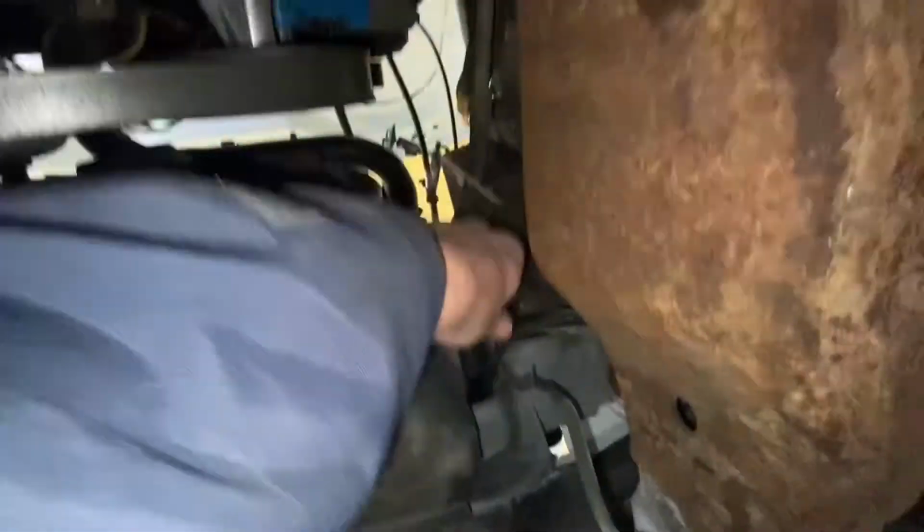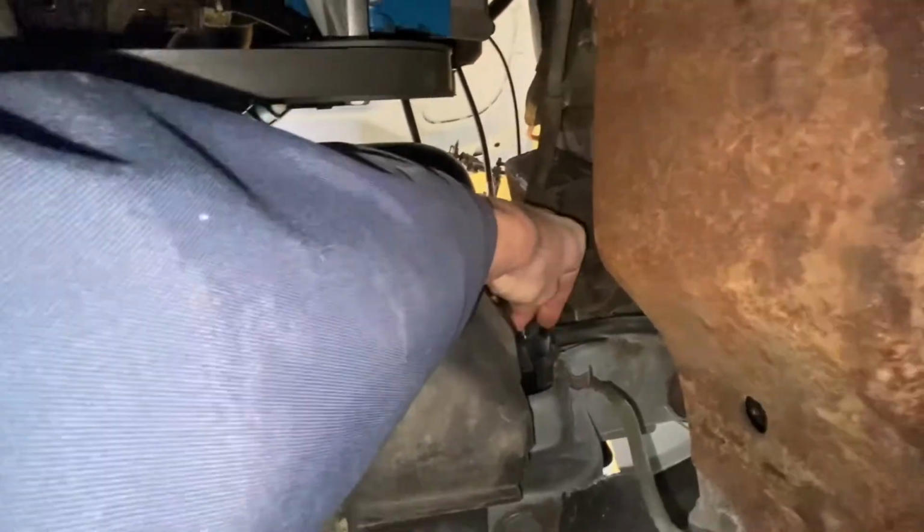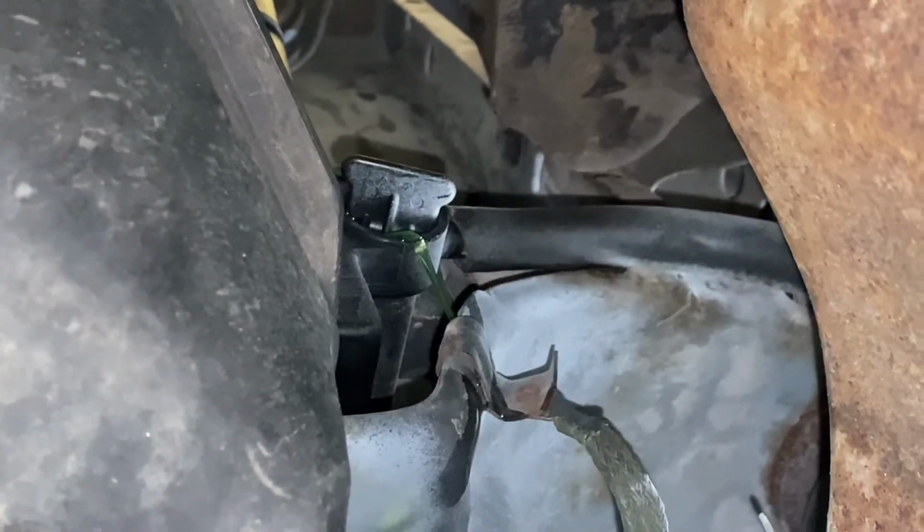So you'll just reach up here and turn that counterclockwise, and of course it just leaks when you don't want it to. So, you know, try to use the hose, and not really doing it. So here we go, I'm just going to be catching that. So that's how you do that. Drain it there and take the top radiator cap off.